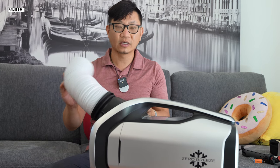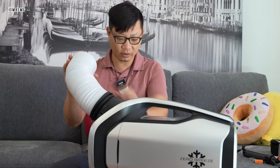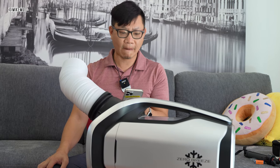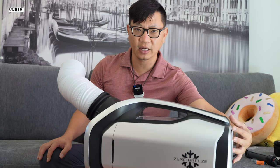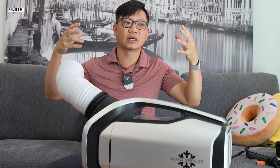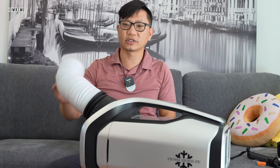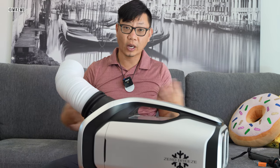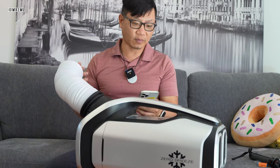I actually use clamps to point it in different directions. I do like that it is flexible — I could jerry-rig some sort of bendable piece of metal attached to it. Can you use this inside an 18-wheeler? I suppose you could. If you're doing it in an enclosed indoor environment, you definitely want to extract and pull in fresh air, so you're going to have to run hoses out. In the kit, they actually include a styrofoam-type foamy insulation piece with two holes in it — don't throw those away. Those things fit the intake and exhaust holes just fine and help you position them correctly.